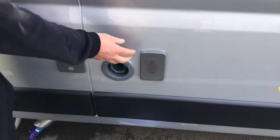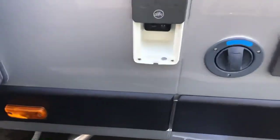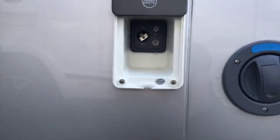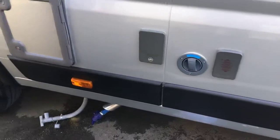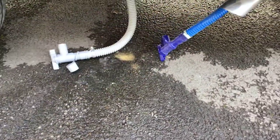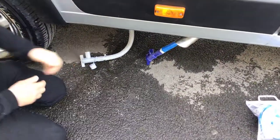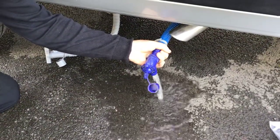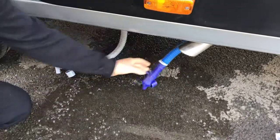You'll never ever flood the vehicle. Underneath, while travelling, the hoses are hooked up on the jubilee clips. When you're static and using the van: blue one for your fresh water, grey for your dirty water. At the end of every holiday turn it, drain it, and leave it open until the next time you're going to use it. Do not forget to put them up when travelling.